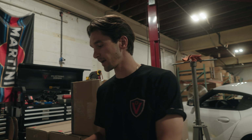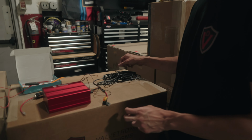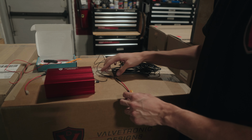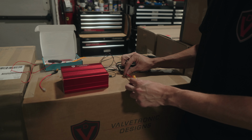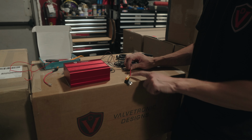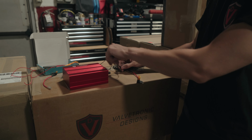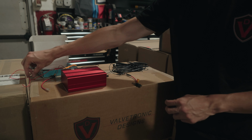So you get all the benefits, but it's important, as I said before, make sure you wire this to accessory power, because if you don't, the car's going to drain the battery, and then you're going to have to get the car towed or have it jumped, which is obviously we don't want that to happen. So again, this is how we did it. Power wire, cut the cigarette lighter end off, soldered this power connection to the fuse box from the dash camera, and then we just soldered in the ground as well.